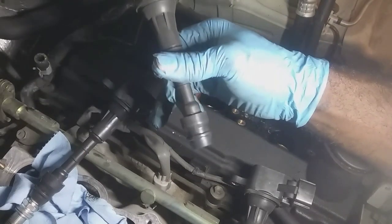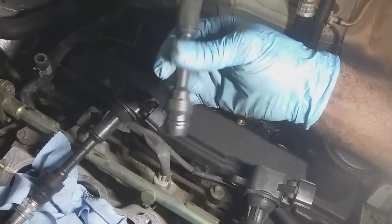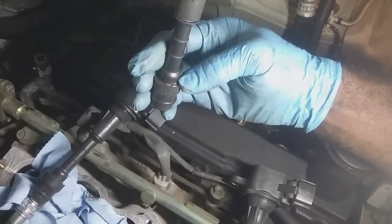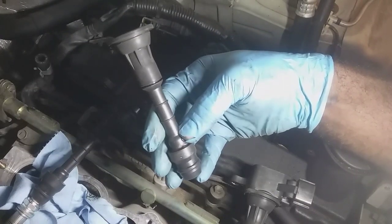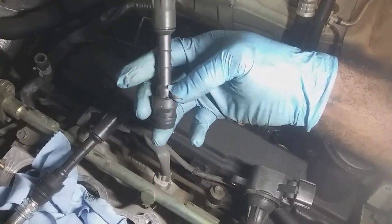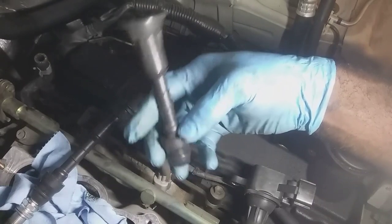So the initial readings of the air-fuel ratio sensor went rich. That's the benefit of an air-fuel ratio sensor, how immediate they respond. It showed richer conditions for a second or two at the time it was picking up a signal that indicated it was a fire issue. So any type of discrepancy in the firing will have unburned fuel. Unburned fuel is going to create richer mixtures.